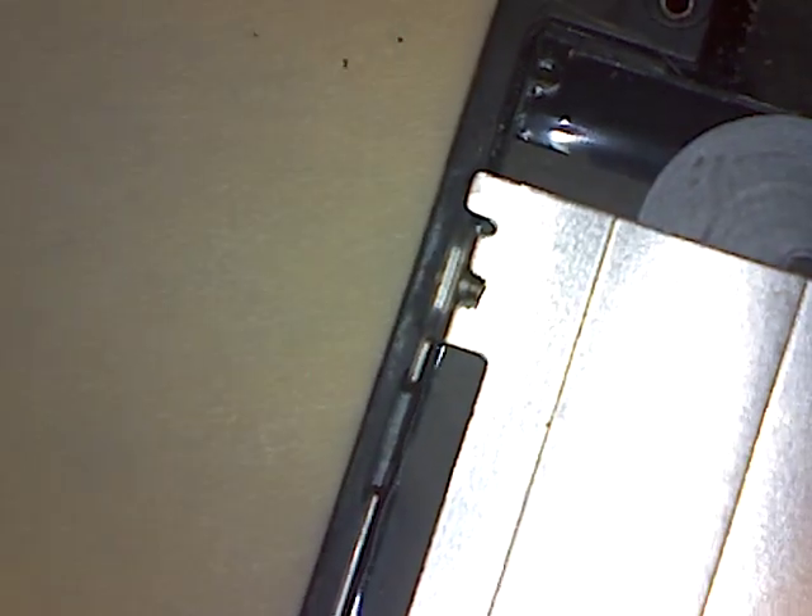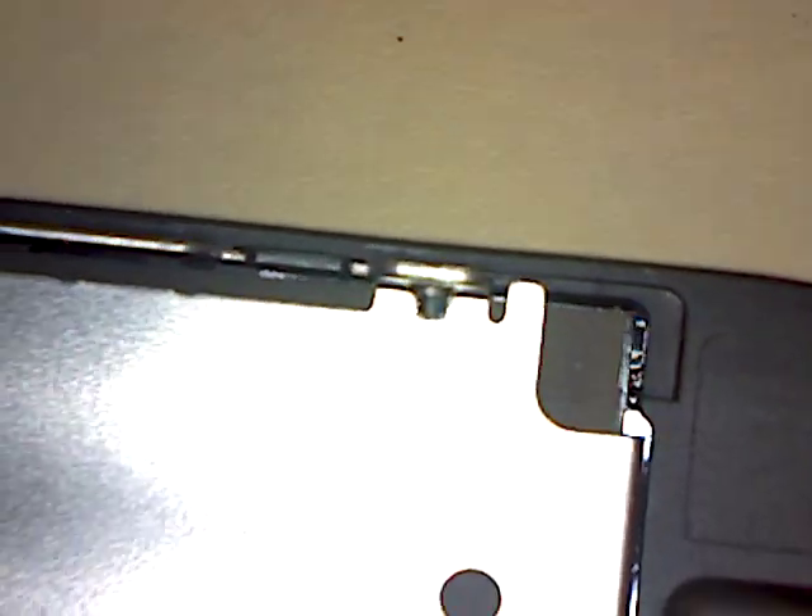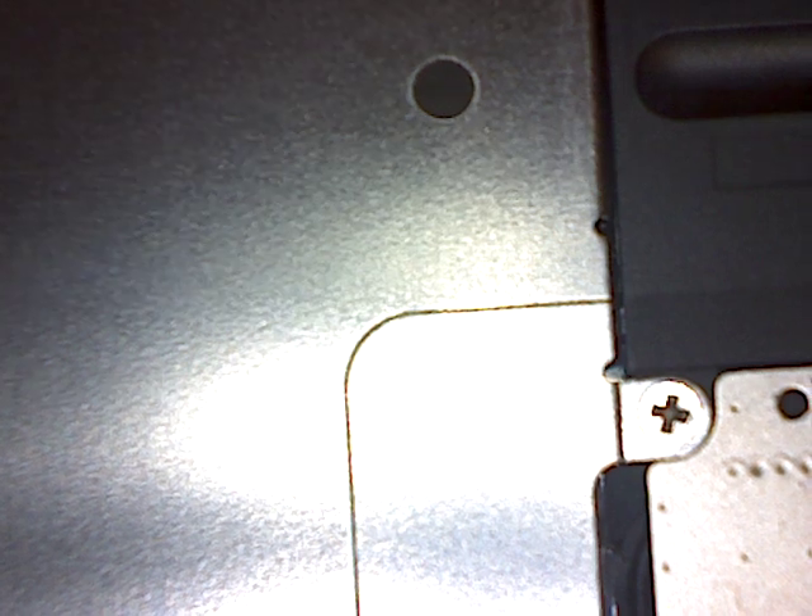This is the back of the camera — that's the ribbon cable that goes to the motherboard underneath here. You can get in from the sides. There's one in the middle, three more, and then one at the bottom, and then the same on the other side. With the middle and bottom screws out, the motherboard will be exposed. This is the bottom, by the home button. I'll go ahead and take the home button bracket out.